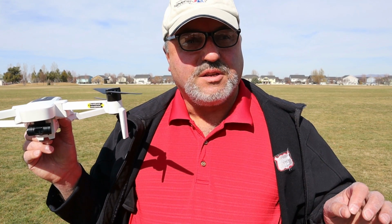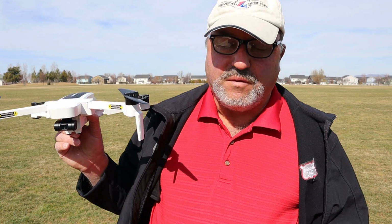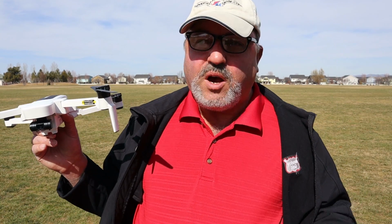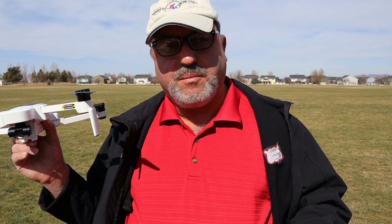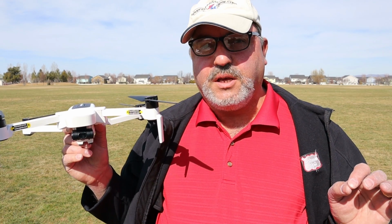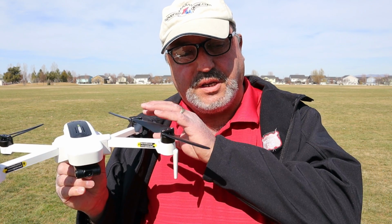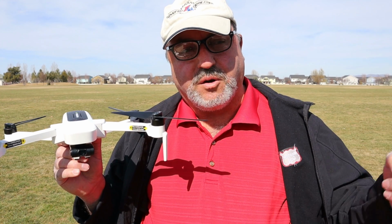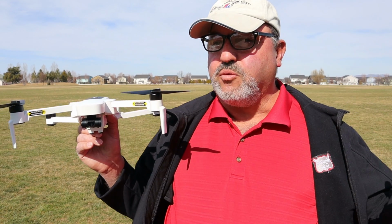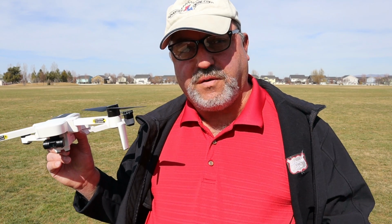I know part of that is affected by the app. I don't know if you can roll back to an older app version. I'm not aware of a way to do that. If any of you guys know, that might be interesting, because you might want to get one of the older versions of the app as well. Although, what I can tell you is you are for sure going to give up the ability of the software in the app and the firmware in the drone to tell you when you have a bad battery, because that came with the last app update and firmware version 1.2.05.